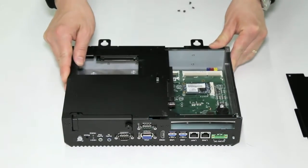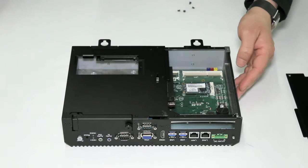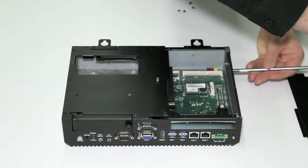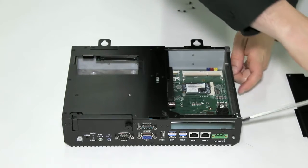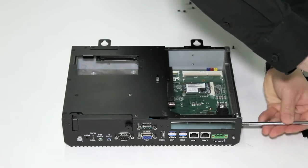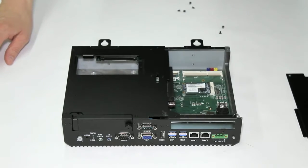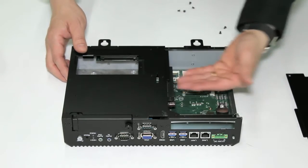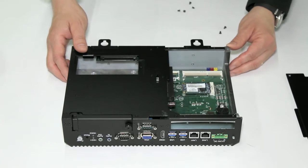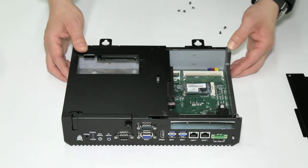On the premium devices, there's a PCI Express slot here. To install a PCI Express card, simply remove the hatch on the side. Once the hatch has been removed, a card can be inserted here and can be accessed from the slot on the underside of the PC. Thank you for watching the serviceable internal components of the Series D premium and standard InTouch panel PCs.